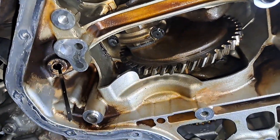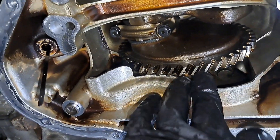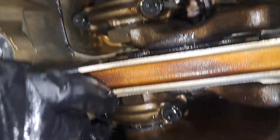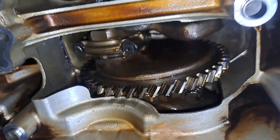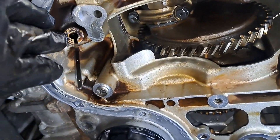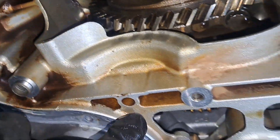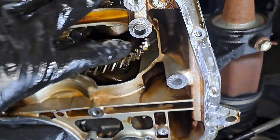Here's our driving gear at the crank for the balance shaft. You want to inspect this to make sure your teeth are not damaged, and that doesn't seem to be the case here. The only thing that bothered me was some heat discoloration — right around there — possibly from manufacturing or welding, but the caps don't have that same purplish color. The engine looks really good inside. I hit it with some brake cleaner in the valley here, so I'm going to hit it again just to get the areas dried up, then put the glue on the pan and bolt it back up.